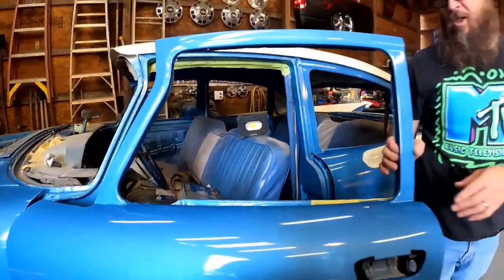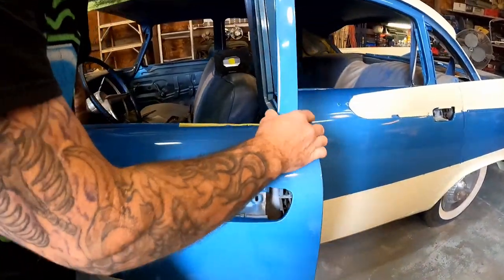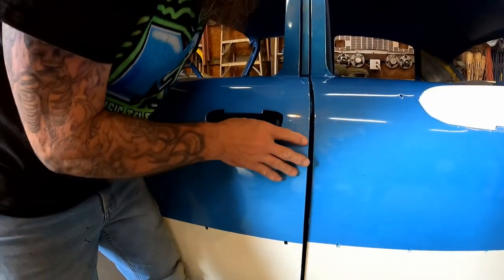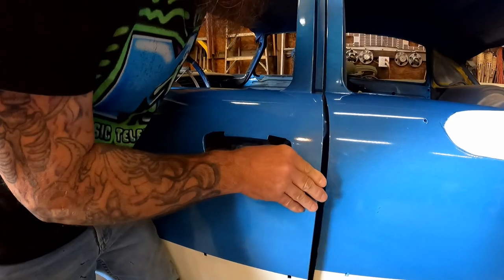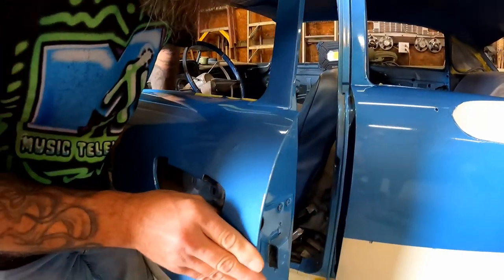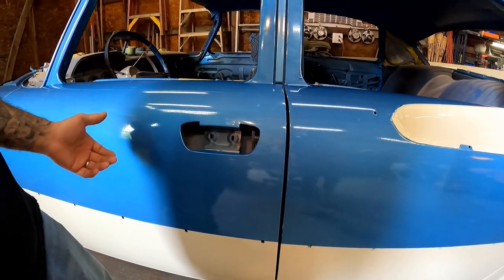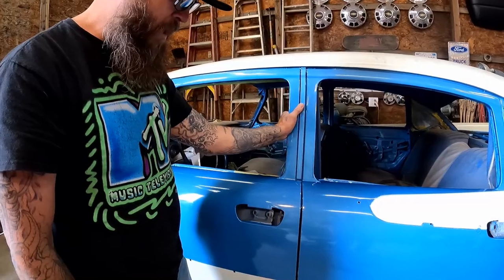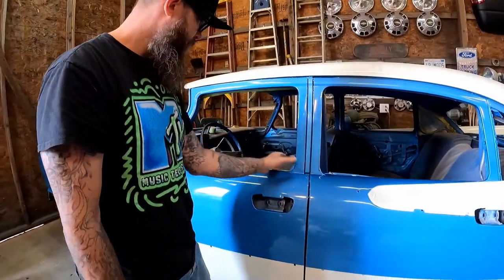Just like on the back door — pull the trigger, get the latch, hold it open, come through here, kind of put it in position. It just moved right where it needed to be. Now I'm going to let the latch loose and go for it. There we go — that felt really nice. We got our two clicks, there's always two clicks on them, and look there's our play for the weather stripping just like we want. That's about all there is to it — it's pretty easy.